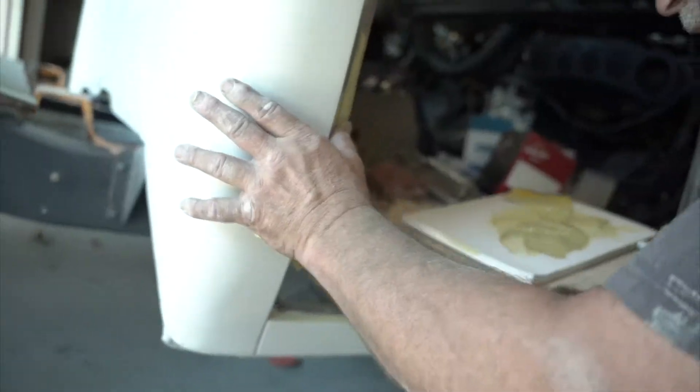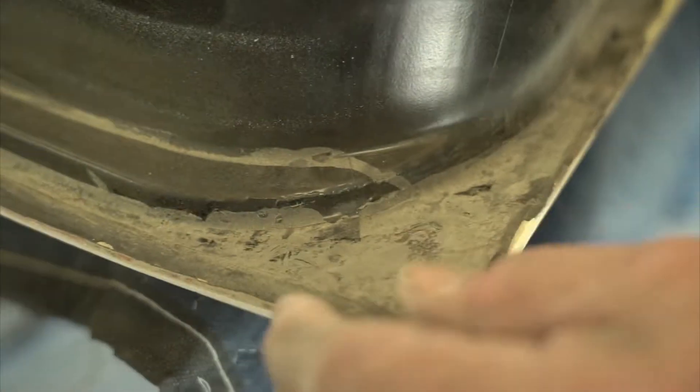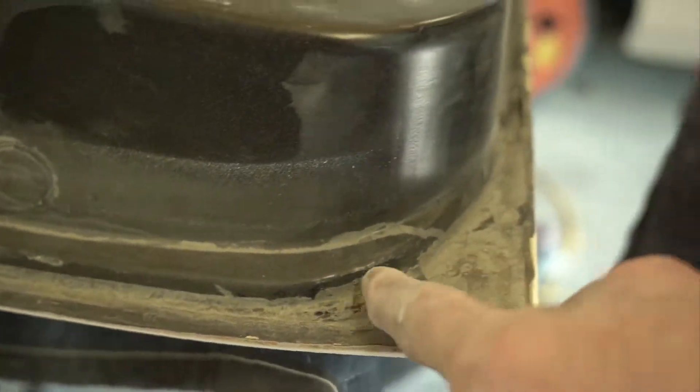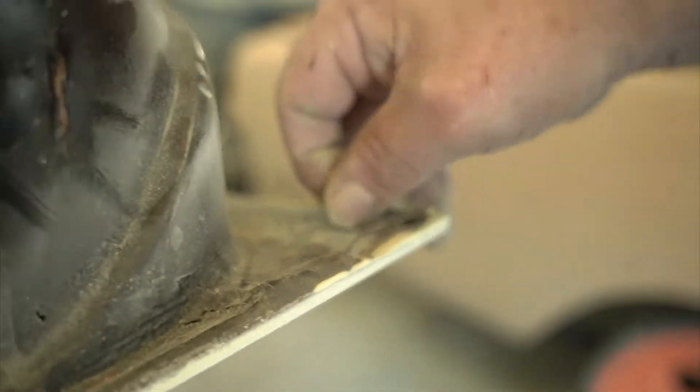Every week's a better week because we get more done. We got the doors off — one door is being primed now, got to do work on the other door on the inside. Once we take all the panels apart we've got to do all the jam work. This truck was wrapped in plastic wrap with a lot of glue, and they just slapped a patch over the rot without cutting it out and patching it correctly. Both corners need to be fixed — there's a little rust and damage underneath, you can see it all peeling up.